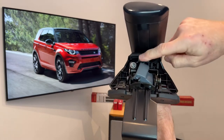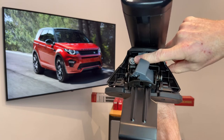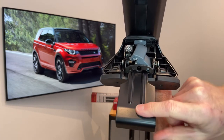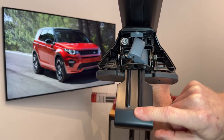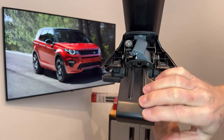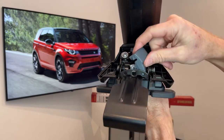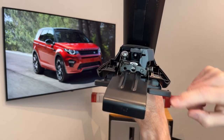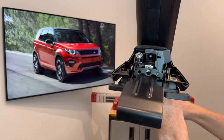There's another adjustment here, and when that is tightened, that will draw this clip against the doorframe. And underneath this panel is the final adjustment — when you tighten that, that will pull this clip up against the doorframe.